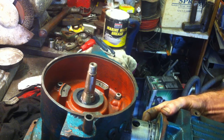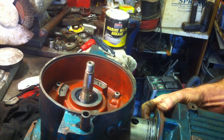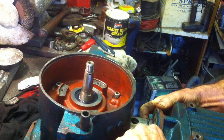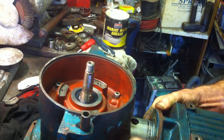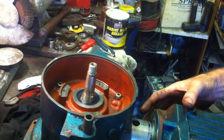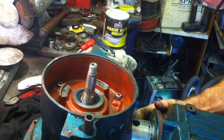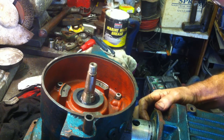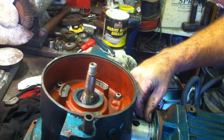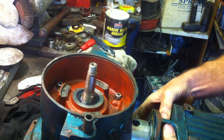So here we go in — we're in. We'll push the ring together and that should slip down one ring. There we are, so that is the first ring in. I've got the weight on my knee. Now the second ring — I want to get the back in first, so I push the open ends of the ring towards me, tilt the back end in, and then tweak with my nails, a bit of a spin on the cylinder, and that's in too.